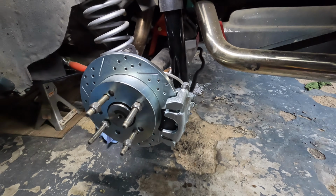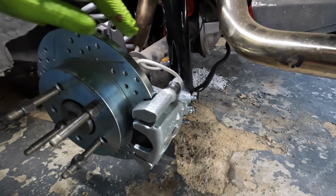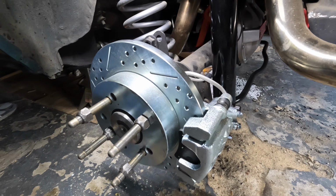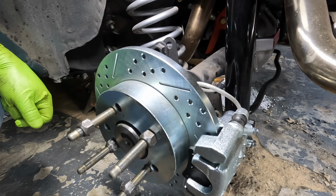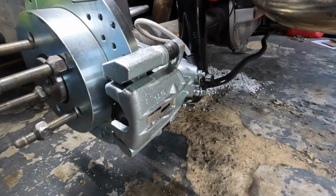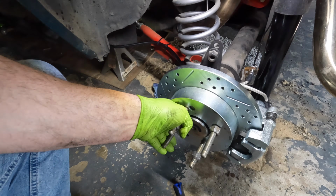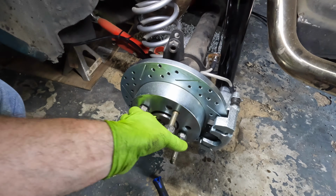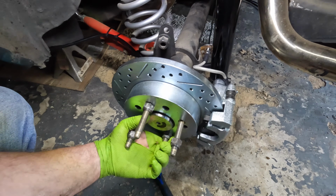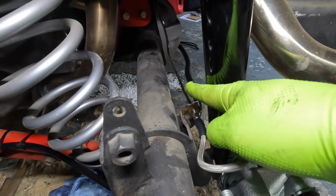Alright. Okay, well this is what it's going to look like installed. So everything's set there. We bled the brakes initially just because when we start doing the proportioning valve stuff, I don't want to be fighting not having any fluid in here. So we bled the brakes. You can pull the handbrake. That's all hooked up and working. See? Let it off. There we go. And pull it. Stuff's pretty good. Let it up. See how nice the brake line's routed.